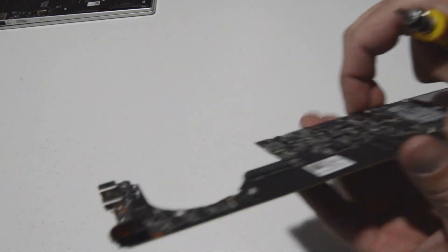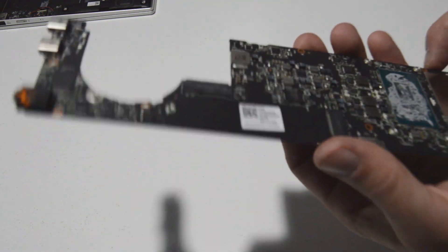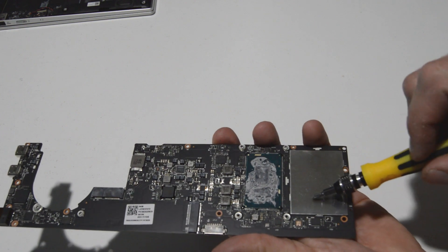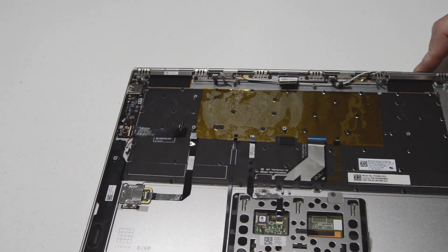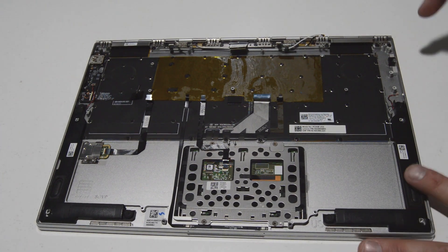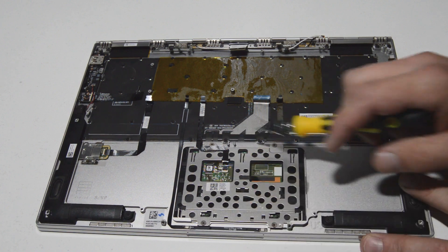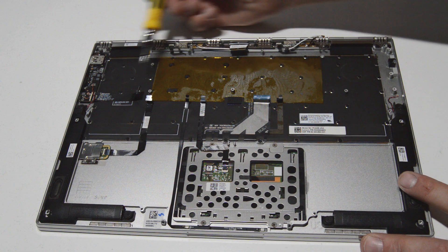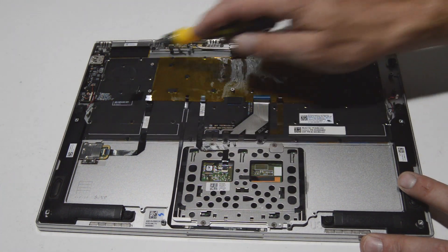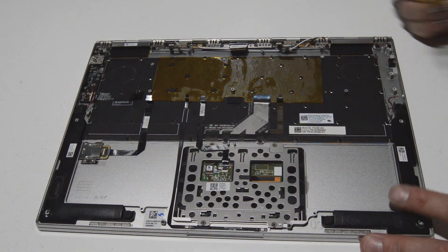That's it for the motherboard — it's a very small motherboard. The RAM does not look upgradable; it's probably integrated RAM chips underneath the cover, so keep that in mind. Back to the palm rest assembly — we're leaving it in one piece, but the touchpad is easily replaceable with four screws. The keyboard is also definitely replaceable with a bunch of screws throughout; remove those and you can pull the keyboard.